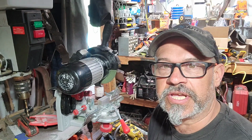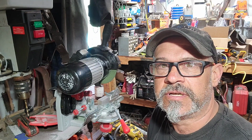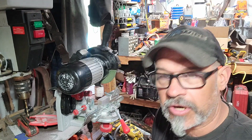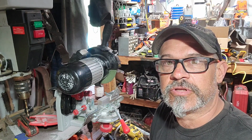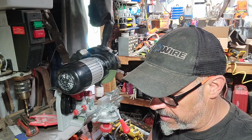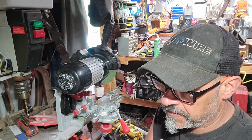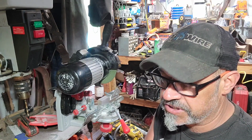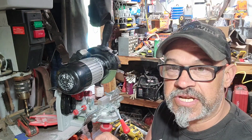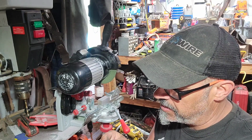For somebody that wants to get into square grinding and doesn't want to spend $1,500, unless you find a used one for $1,000, if you're lucky, a Silvey or whatever, this square jig works. And I'm sharpening up this chain and I'm gonna go cut a stump off with it to see how well it works. It's a residential Douglas fir stump. It's fairly hard.